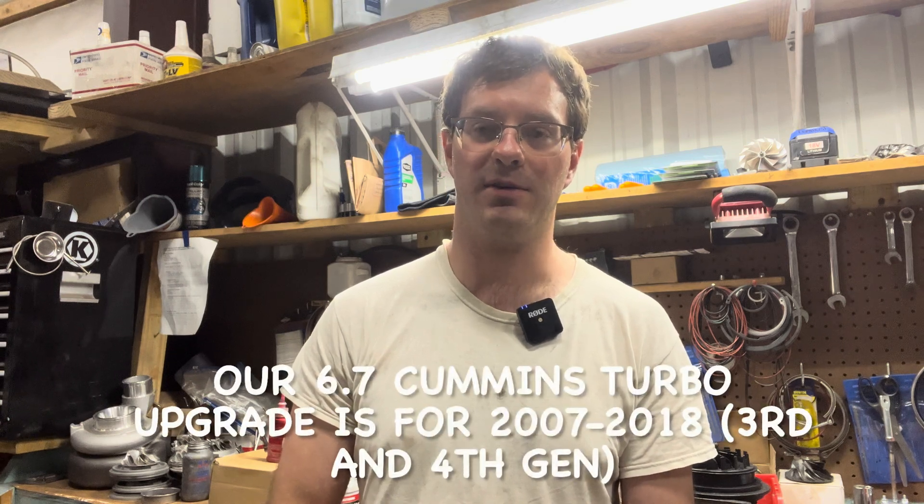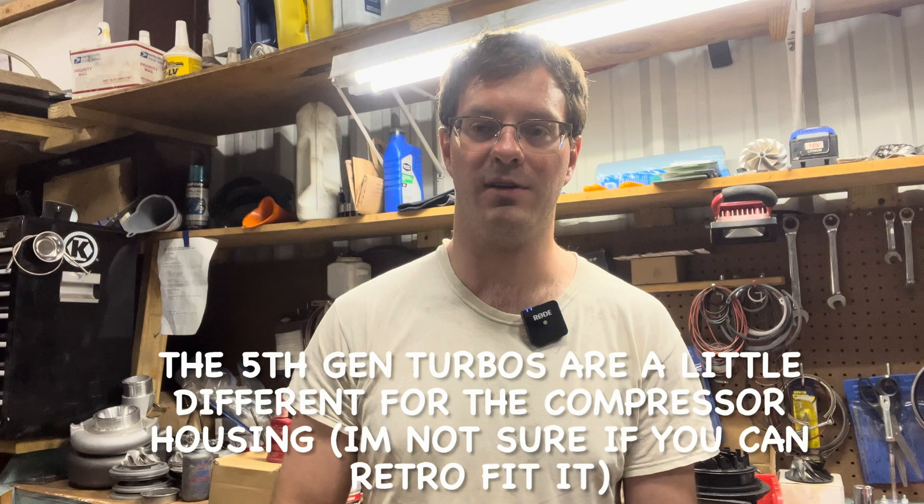The VGT nozzle is a Cummins patented part, so you're not actually supposed to sell those — though some people do sell them on eBay and Amazon. We do have new upgraded turbos for those, and we have rebuild kits for these turbos: for the VE which is 2007 to 2012, the HE300 VG which has two versions — 2013 to 2018, and then the 2019 to 2025 fifth gen. That turbo is a little bit different, so I made a separate rebuild kit just for that one as well. So there are three different versions of rebuild kits for these turbos.